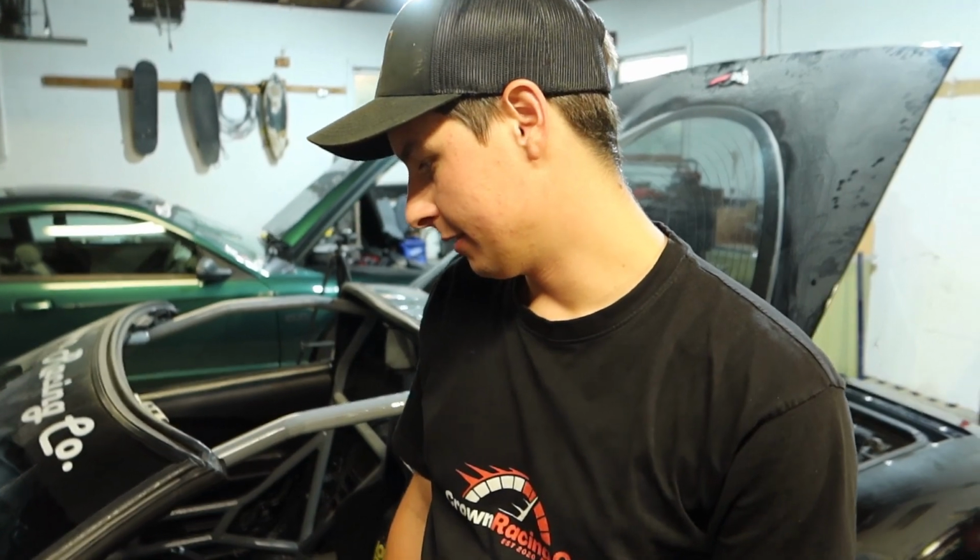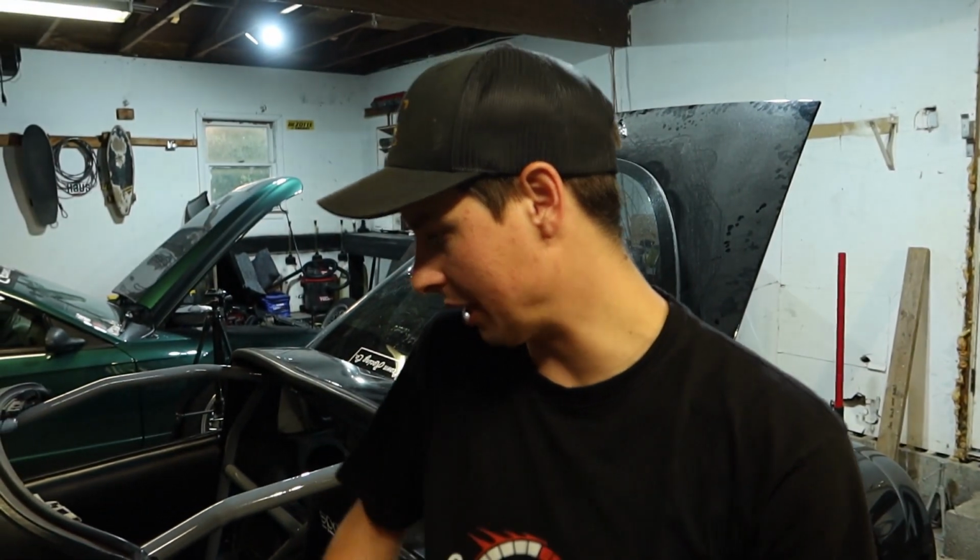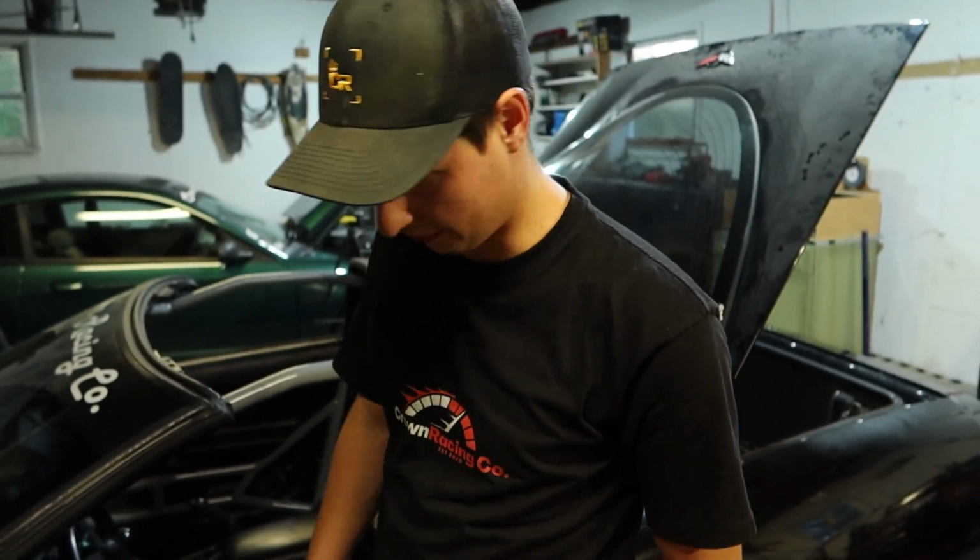Rip. Well, back to just pulling on the steering wheel. Yeah, we might pull on the steering wheel. Since we already got it, we could hit it with a hammer and try to pull on it a bit. Or we have to drill into the steering wheel and then drill and tap new holes for those bolts to go. This is really fighting us. Yeah, this is difficult.